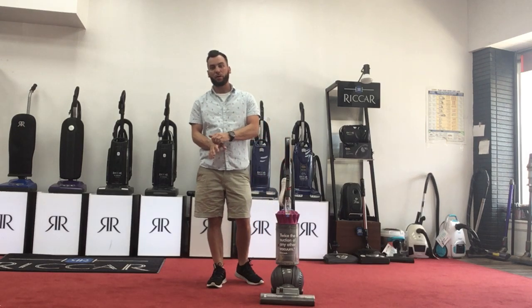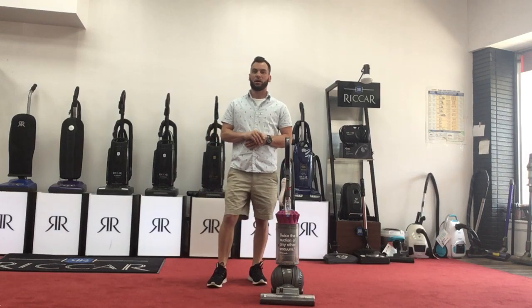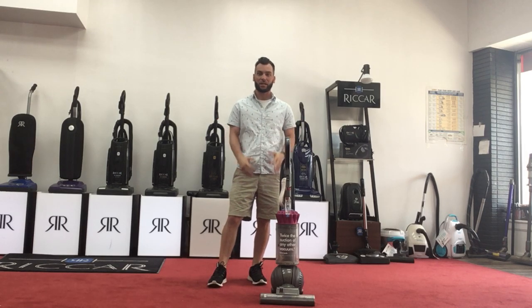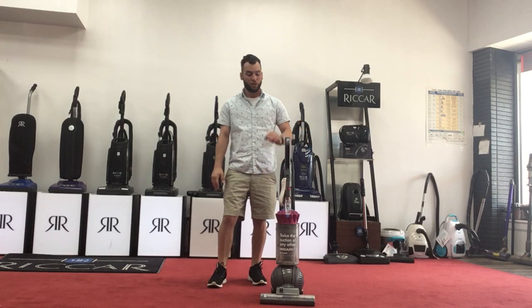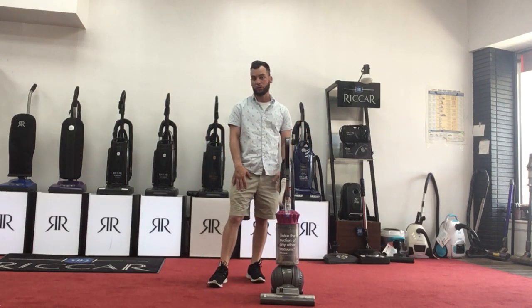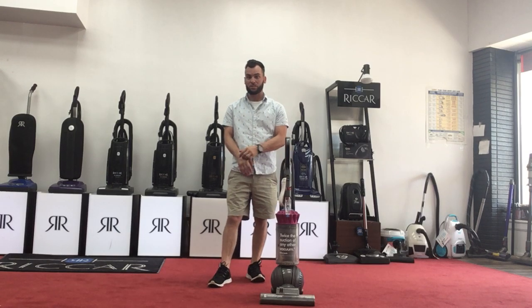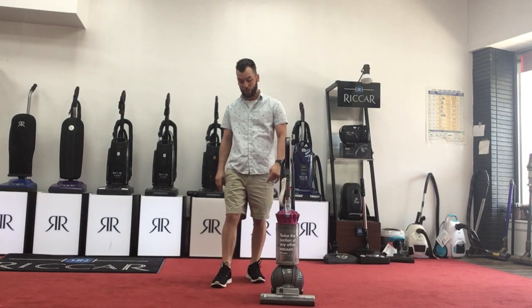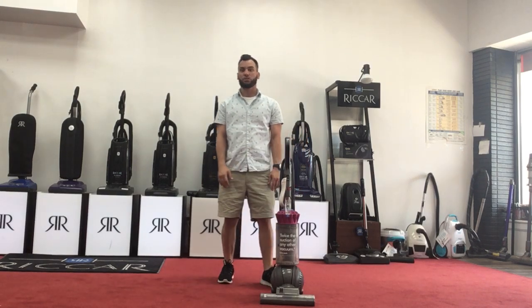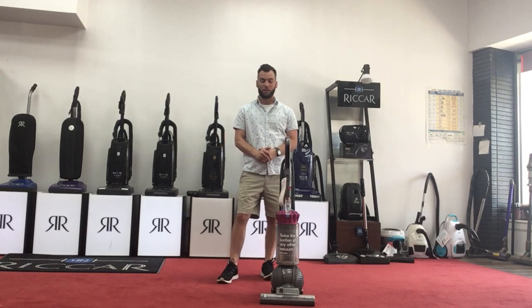Sometimes you may smell a bad odor if you have pets and things like that. You may suck something up that got through the vacuum and it's just got a really foul smell. You can bring it in to us and we can clean it, service it, and have it smelling like brand new again. Or a burning smell. Sometimes we do get the burning smell. It could be because of the roller. It also could be because of the motor. So there are a couple of things that it could be for why it may be burning.